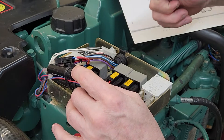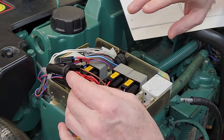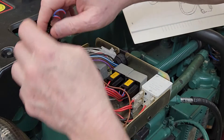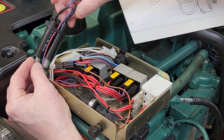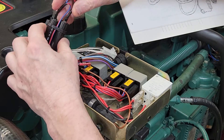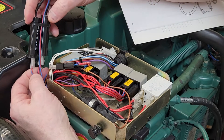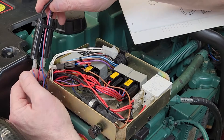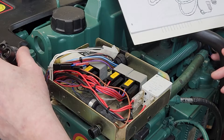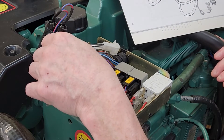So if you're having problems cranking the engine over and it won't start, you have the dashboard lights up and the push button panels light up, I would come in here and start looking for voltage potential while it's cranking. On one side of these diodes you'll see red and purple wires and there's a jumper from one to the other. The output wire of the diodes is tied together — you have two different circuits — and those diodes can get corroded. I would look at these diodes, measure them, and see what resistance you have. The part numbers are from Pectron from a long time ago but they're still available. There are other connections here which could also be a problem, so look at those connections as well.